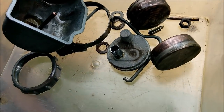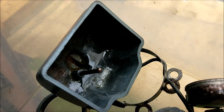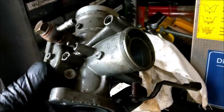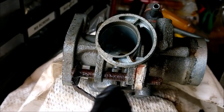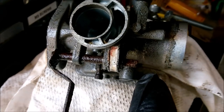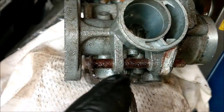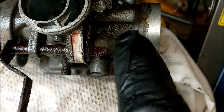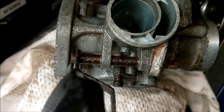The carb has had a nice clean and things are looking a lot cleaner now. I've got to check that float, make sure it's okay. But I'm not having much fun with the carburettor, sadly - the choke bar and butterfly is seized. That is seized in there. I've managed to get the nut off and I'm really lubricating this a lot, very gently tapping with my toffee hammer - just gentle taps, this end and that end, trying to break that seal.